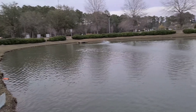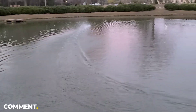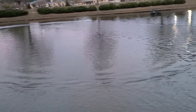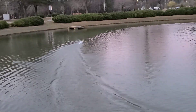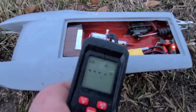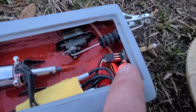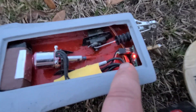That's at least 30 miles an hour. I think the Tiny Titan is quicker — I really do. I might try one of those V2 ZTW ESCs; they've got a 30-amp that might be good for this boat. Or another Dynamite — those are my go-to. Got a little bit of tuning to do but I'm happy with it. Whoa, out of control! The temps on this boat are good. I had a couple little power cuts but it's not the ESC or motor — it's the receiver. It doesn't have a case and there's some water in the boat, so we're going to balloon that receiver.